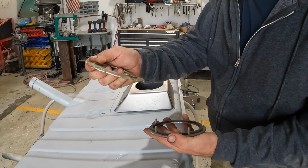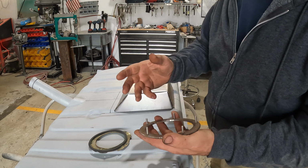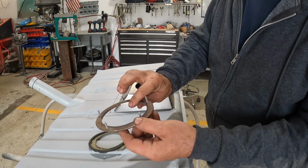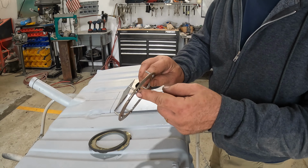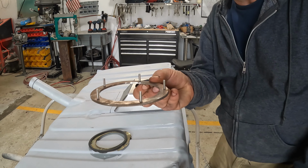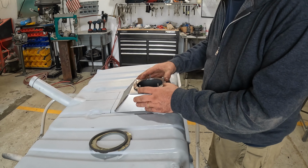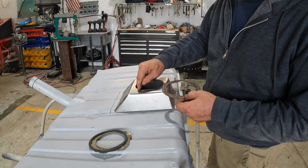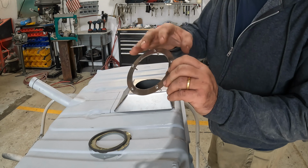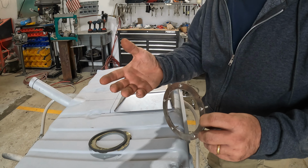Basically, here's my upper locking collar, I guess you could call it, gasket, O-ring, whatever you want to call it. And I went ahead and drilled and tapped 5 holes that I could put in some screws that would act as studs. So this is actually going to sit this way, not that way. Now I need to align it and basically relieve the areas in my extension where the heads of the screws are, or actually not even that far. I just need to drill holes and I'll screw all the way through. It'll make sense here in a little bit.